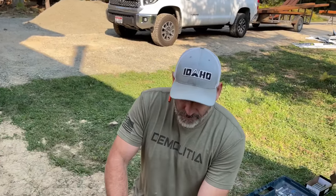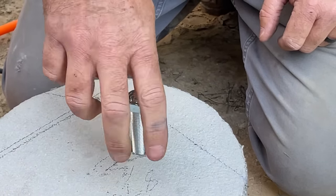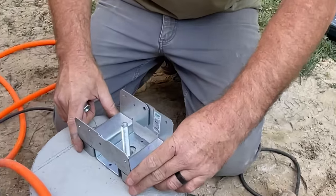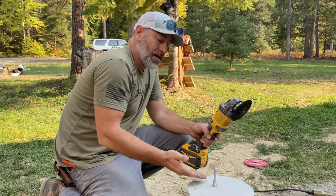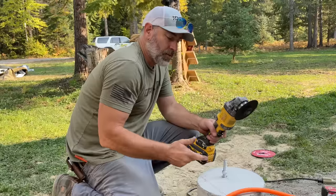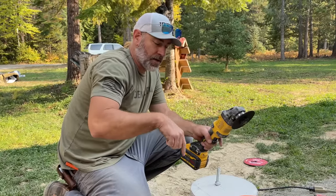You can hear when it's done and it hits the bottom - it's totally solid, changes tone, the hammer bounces right off of it. The threads aren't even messed up. We're going to have to cut these off though - our bracket goes on here just like that and then we've got a washer and a nut to hold it on. If you're going to have to cut a bolt off like this, it's best to put the nut on first, cut it off, and then when you take the nut off it'll fix the threads.